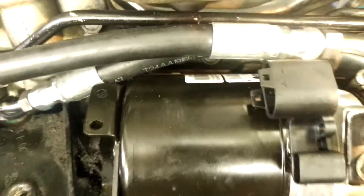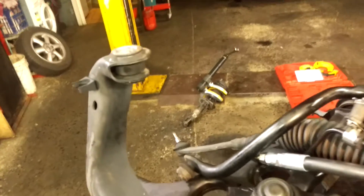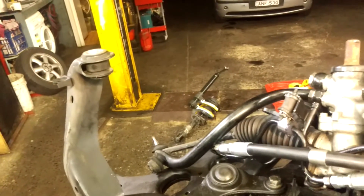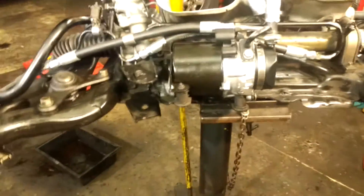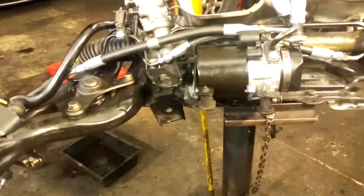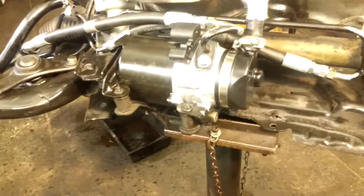As you can see, I've replaced it with the ZF pump. When the strut top bearing mounts seize, these pumps leak and fail. When the struts don't seize, these pumps leak anyway.